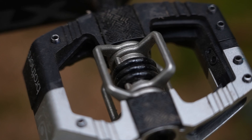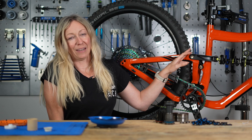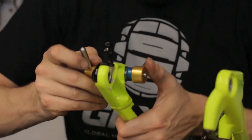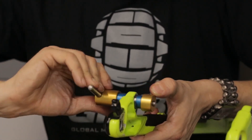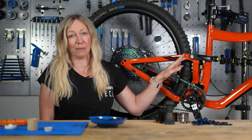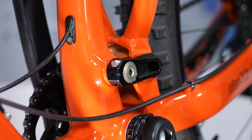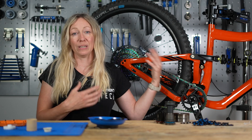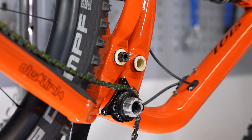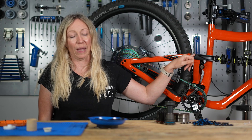You can go for products like Crank Brothers who use a combination of the two. In fact, Crank Brothers have recently moved to igus bushings and say their service periods have extended by eight times. Bearings are obviously used in linkages and that's why they need regular servicing so your suspension remains smooth. When these things wear out, that's why we start getting a baggy feeling or a knocking in the rear. Brands like Nicolai and Ibis are using a combination of bearings and bushings — there's actually a bushing in this linkage down here — which means rigidity remains in the rear suspension even when those bearings start to wear out.